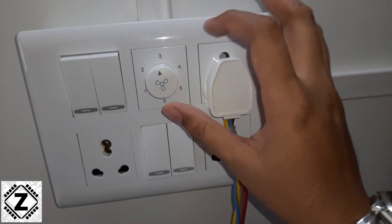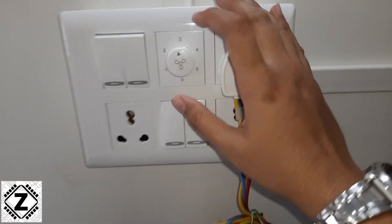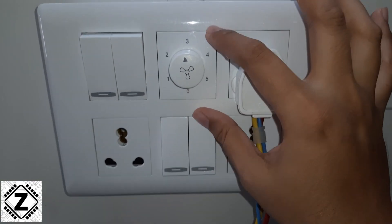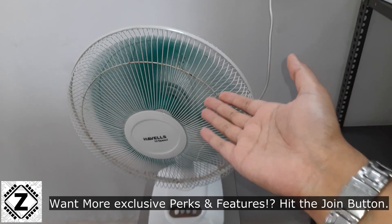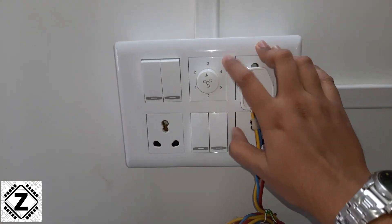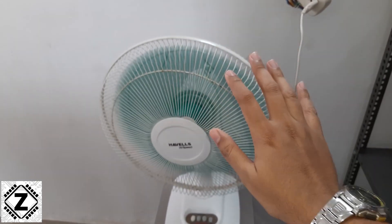At 30 to 33 watts, I do not recommend you go lower because the fan is already quite slow and it might overload the motor. So I recommend a minimum of speed 3 — though it depends on the kind of dimmer you have, so you might have to experiment a little bit. For me, this particular speed number 3 on the digital fan speed regulator is very silent.